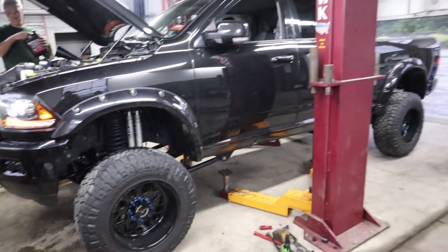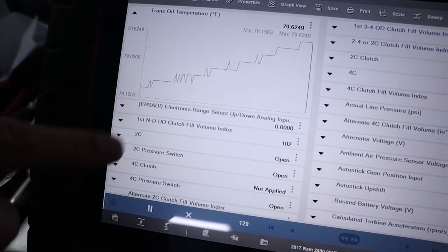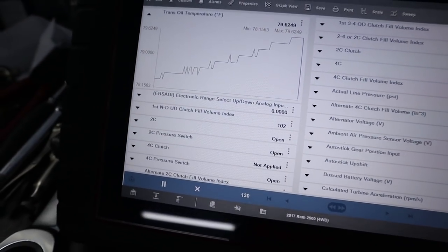It's alive, guys! We're getting her filled up. We need to get the transmission up to temperature in order to do the quick learn process. I've got it hooked up wirelessly watching the temp — we started at 78 degrees and it's almost up to 80 after about a minute. A lot of times with these Chrysler products we end up having to drive them because you just can't get the transmission hot enough idling to run the quick learn, so we'll probably have to take it out very gingerly.